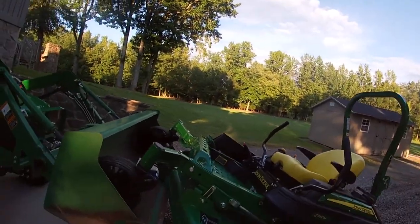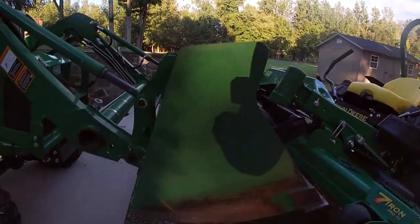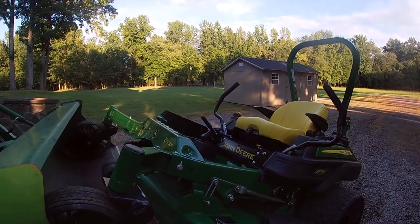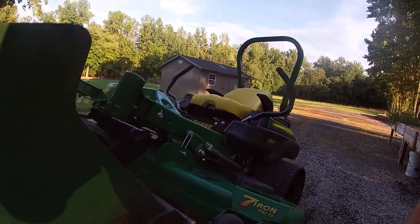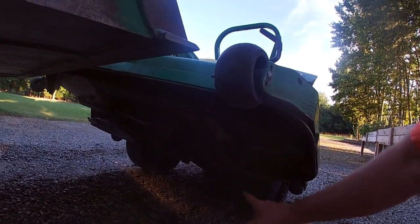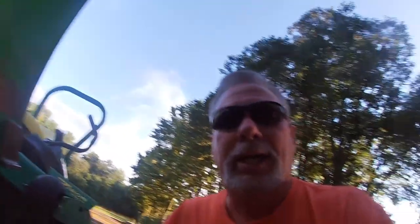The first trick that I love to do is to use my bucket and use the hydraulics off of it to lift the mowing deck up. I've got everything locked down and I've put a safety block in just in case it was to fall — it won't completely fall on me. I'm only going to stick an arm in at a time, not my whole body underneath here. I've got another tool to zip these off with — let me grab the tools and I'll show you what I'm talking about.